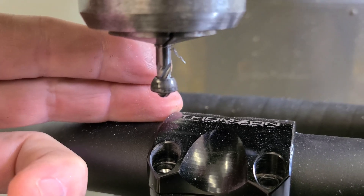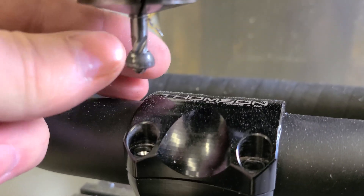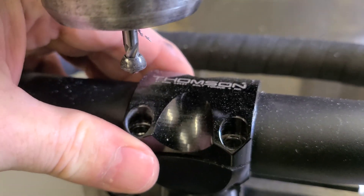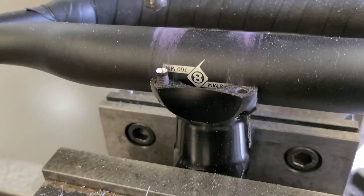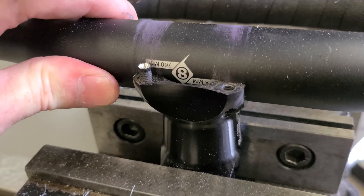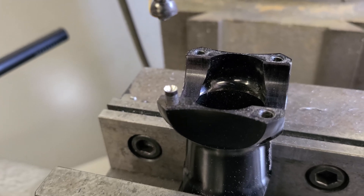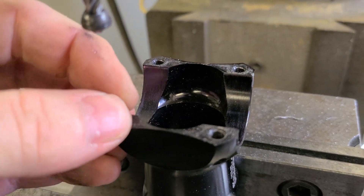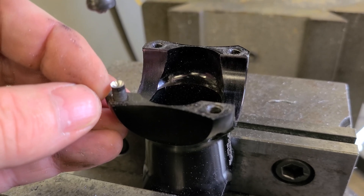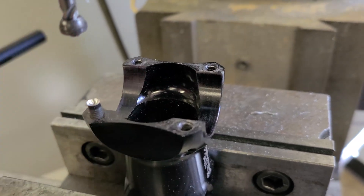There you can see it just pops the head right off. When you're pretty close, that'll be real hot. Now this cap should come off and what we're left with is trying to get that stud out of there. If required, maybe a little heat, back and forth, a little penetrating fluid — we'll see.